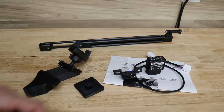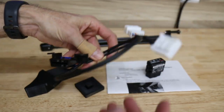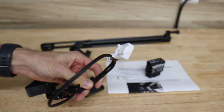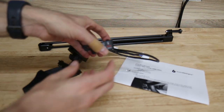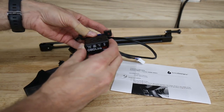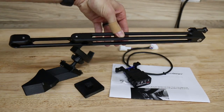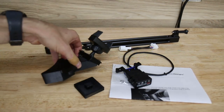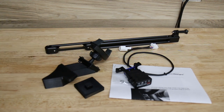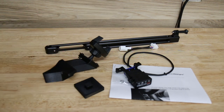Some people out there have been working hard at tapping into that and have created adapters like this one. It connects to our ASC ports on the car, and then we have the adapter for the OBDLink MX, which will give us Bluetooth capability to view the additional CAN bus data. I also grabbed a GoPro seat rest mount and a 3D printed phone mount to actually mount my phone in the car, since there's not a great place to mount phones or tablets in the GR86 without something like this. I'll put links to these things in the description.